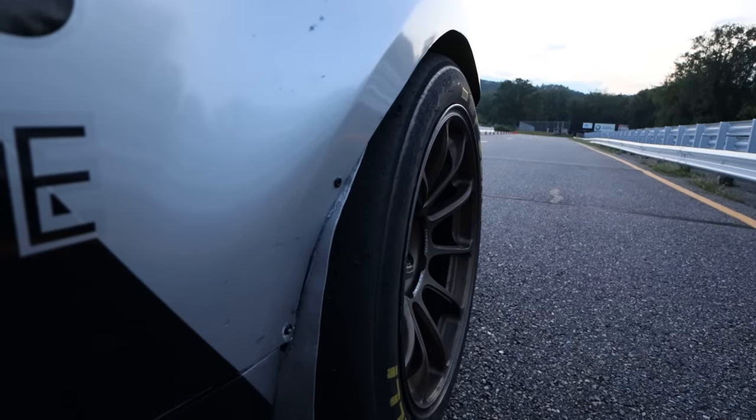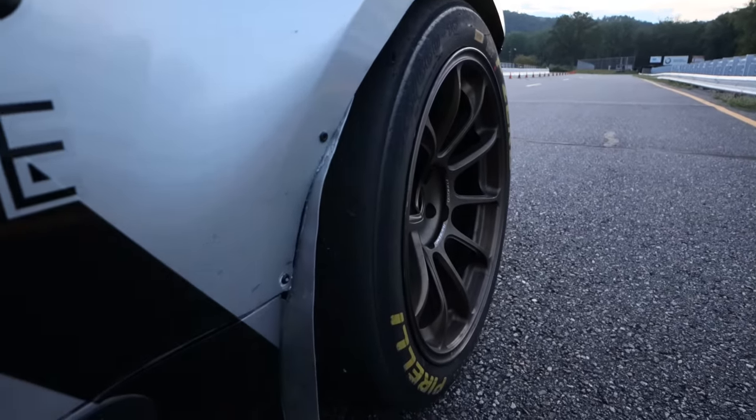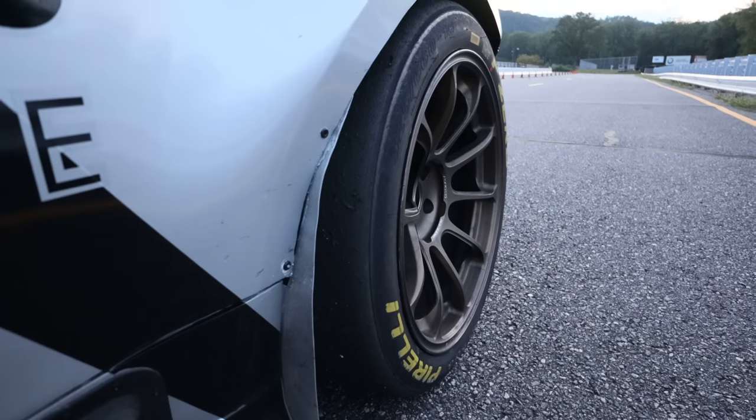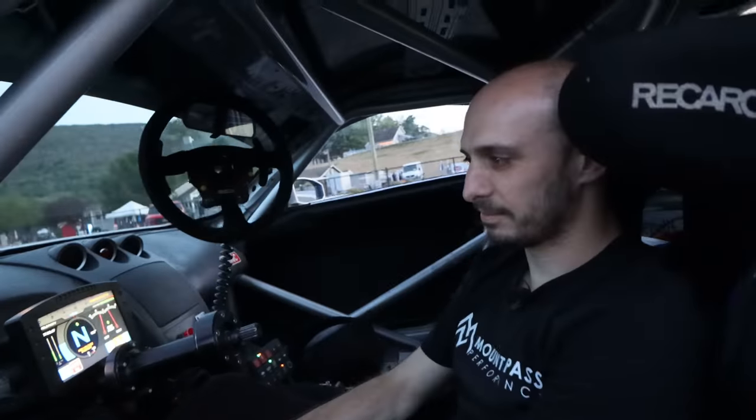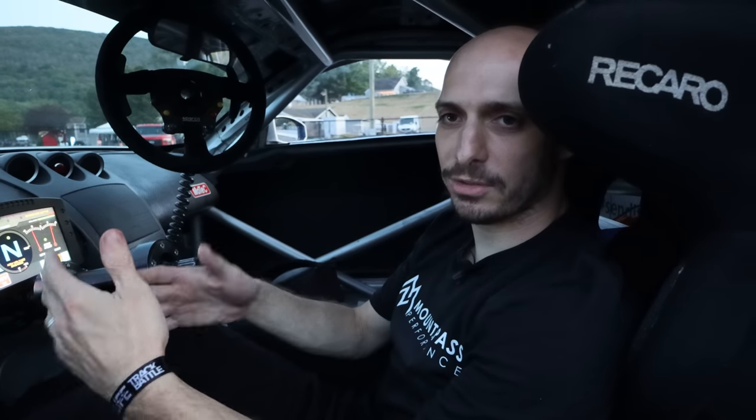It's visibly a lot. Yeah, that's 5 millimeters, from 1 mil out to 4 mil in on each side. Because you want it to be straight when you're braking. This is basically just a pit check, so we make it move a lot in the pits to make sure it's working. But when it's on the track, it's doing all kinds of different stuff. In the brakes, I usually do have some toe in and all kinds of different stuff.